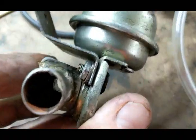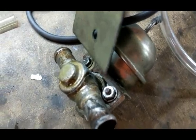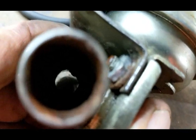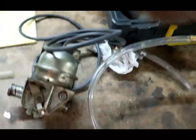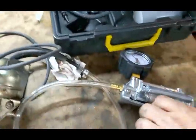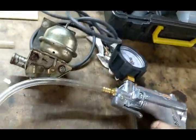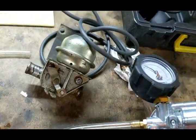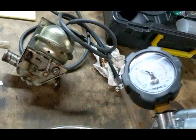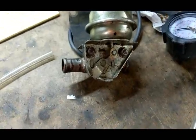I've got it on the bench. Here is the device — you can see down in there it's pretty ropey. I did a quick bench test before I started this video: if we apply a vacuum it goes up nicely. I release it halfway up, the vacuum releases and it opens — so it's normally open, which is good. If I get it fully open — that's where it was sticking — and I release it now, there you go, it's stuck. Demonstrating the problem.